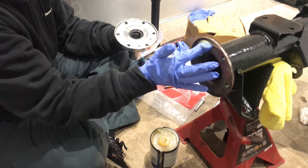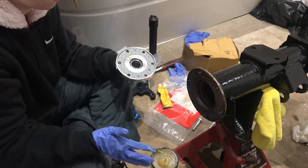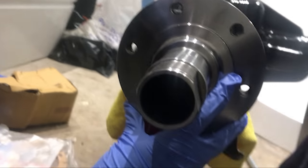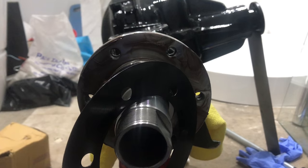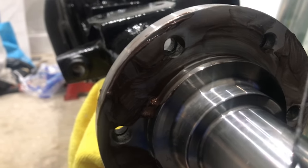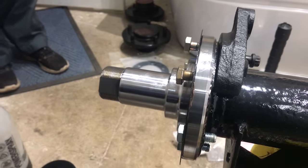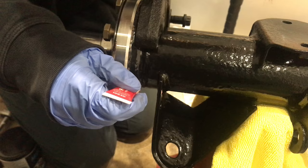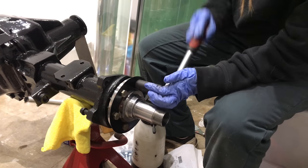Then I'm just putting a slight smear on the end of the axle, on the end of the flange. This just helps to soften the gasket a little bit and help it on its way to sealing, and it also keeps the gasket stuck to it while I'm trying to put this on. I'm just aligning up the bolt holes, making sure there wasn't too much grease in those bolt holes because it will interfere with the Loctite I'll be using on the nuts later. I've just smeared that surface with a bit of copper grease and I'll be fitting some brand new inner mud shields on there as well. I did use 10.9 strength bolts — I had to order these specially. I wouldn't recommend using the normal 8.8 bolts; these bolts should be rated to the 10.9 strength. The gold-coloured bolts are the ones in question.